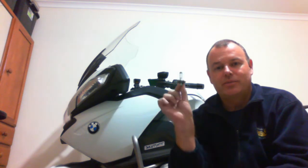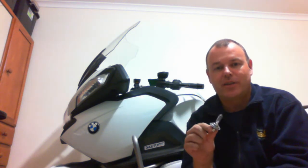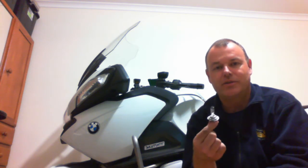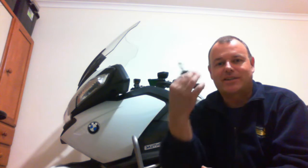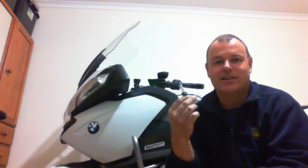It's a 2011 model and I've found that it likes to eat the cheap bulbs. Here in Australia I've been using the SCA Super Cheap Auto globes and I probably get about 10,000 kilometers on a globe. I find it a bit irritating when it's time to actually replace the globe because you have to put your fingers in the innards of the fairing, and the first few times I used to get quite scratched.